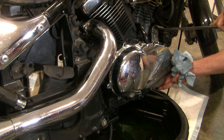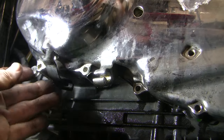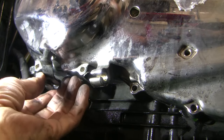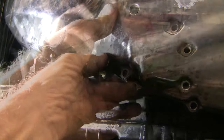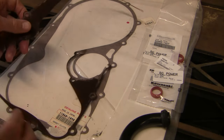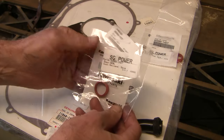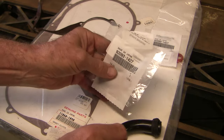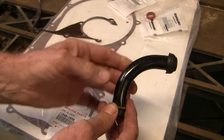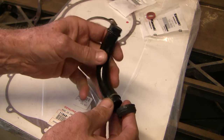Based on the dealer's repair manual I had this taped forward, but when I was pulling the case off you can see that lever moves out. So it looks like the lever has to be out for the case to come off. The parts have arrived — this is the clutch cover gasket and here are two rubber seals. You might be tempted to use RTV here, but remember these seals need to retain flexibility because when the pipe comes off the clutch cover the seals need to give way. If you use RTV it may be a bear to get this out next time. So I went with the OEM seals.